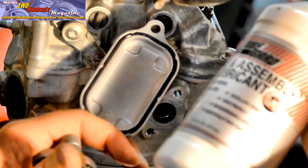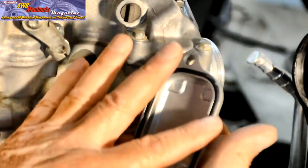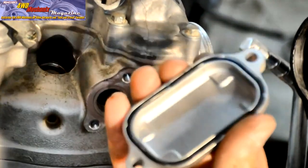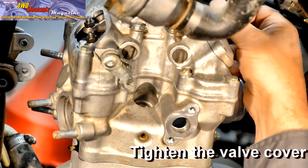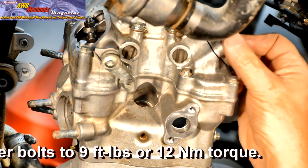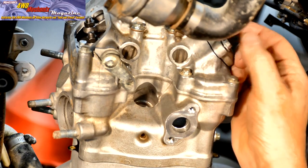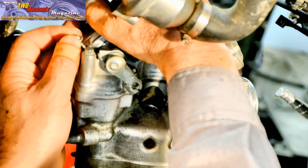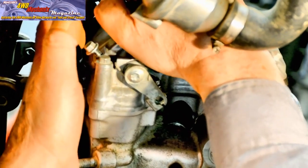A light film of lube guard on the valve cover o-ring helps assure a proper seal and preserves the o-ring. Install the valve covers, tightening screws evenly to prevent warpage or damage to the o-ring or the mating surfaces. Tighten these bolts to 9 foot-pounds torque using your torque wrench. Tighten evenly and then cross and bring the tension up uniformly.